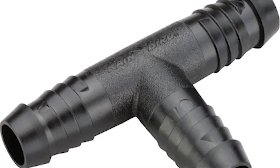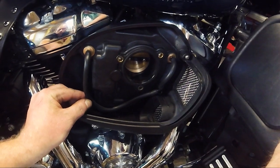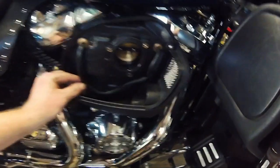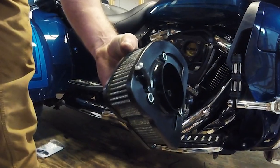It is now time to begin routing the hose through the exit hole of the backplate. In many cases the T-fitting itself can fit inside of the airbox, leaving only one single hose to be routed out of the exit hole. As you can see here, there are hoses leading from each breather bolt connected to the T-fitting, that is then routed out of the airbox.